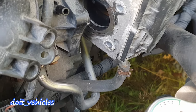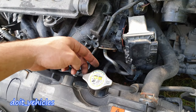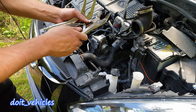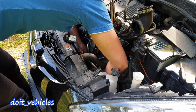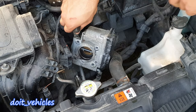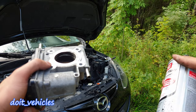If you have a look at the other side you can see there is a lot more carbon build-up compared to the front side. I'm going to completely remove the throttle body, which means we have to disconnect these coolant hoses. I've got 2 lockable pliers which are going to help me obstruct the coolant hoses so they won't leak. Now the coolant is hot so be prepared — there's not much coolant coming out. Let's take this throttle body and clean it up very well.